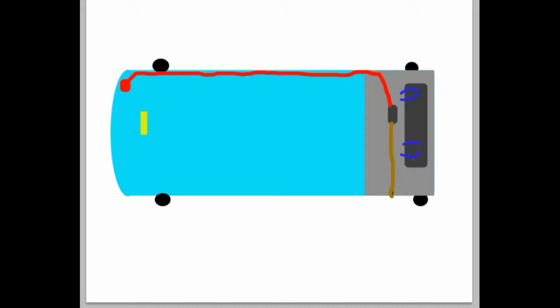Just remember which one. In this example, we're using a 2-channel, so we have 2 subs and 2 channels on our amp, or if you have a mono amp you can hook up really as many subs as you want to it. You'll have smaller ports on your amp. There'll be 4 of them: a plus, a minus, a plus, and a minus. So you'll run the plus and minus from that sub into those terminals, and the plus and the minus from the other sub into those terminals.